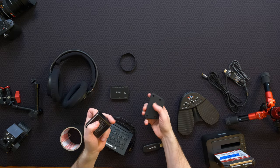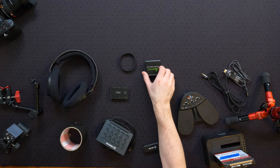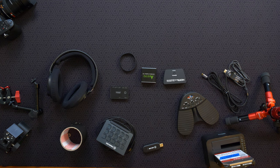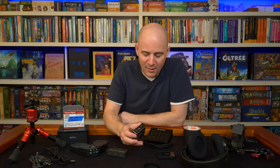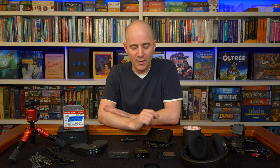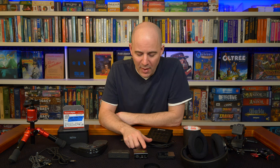Let's talk about some of the gadgets used to wire things to those two monitors. There are splitters, which take one HDMI and send it into two, and switchers that switch between multiple inputs sending to one output. You can get a powered version of these that power off a USB plug, and then unpowered ones which just use power inside the transmitting cables. I've found that the powered ones are more reliable. The unpowered ones occasionally lose their signal and just flicker for a minute — they usually keep working, but they'll flicker off briefly and then back on.